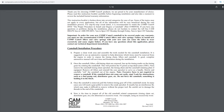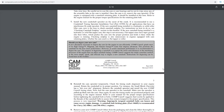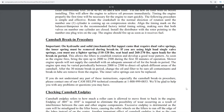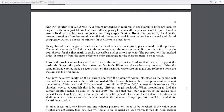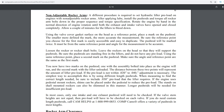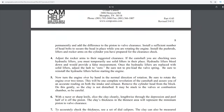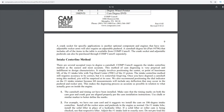If you're going to get this cam, you need these valve springs. You need to block off the variable valve timing. As opposed to throwing something together — there's Moe's Performance, there's Green, there's about 20 cam companies out there. Some were like, here's your big cam. But they didn't tell you that because your variable valve timing moves so many degrees, you only have two or three degrees of play and you're going to smash your valves into your pistons.